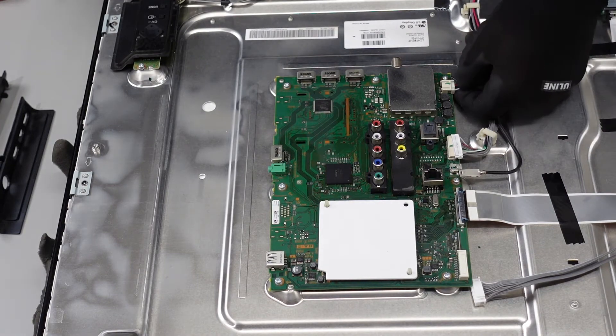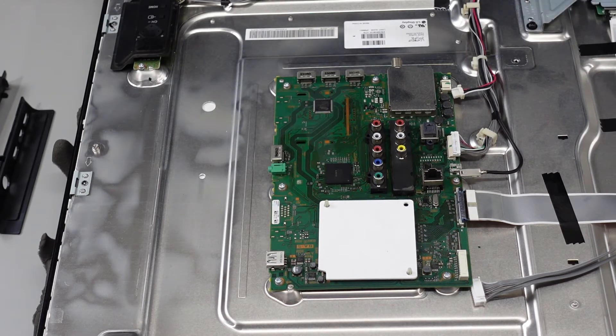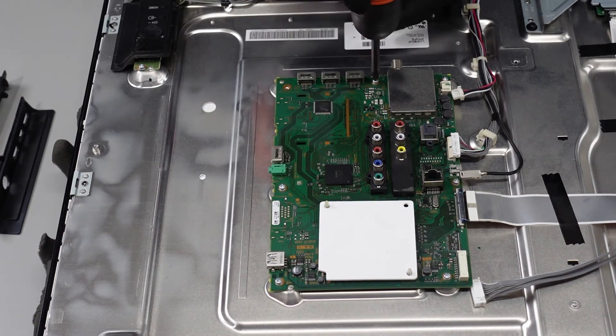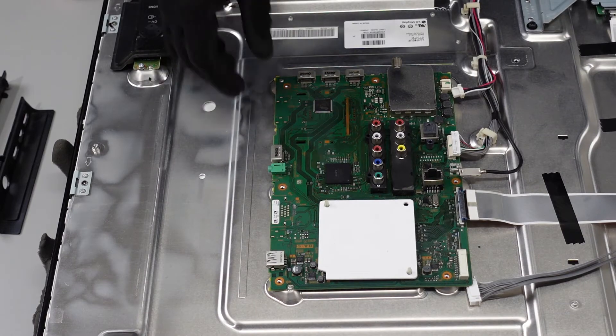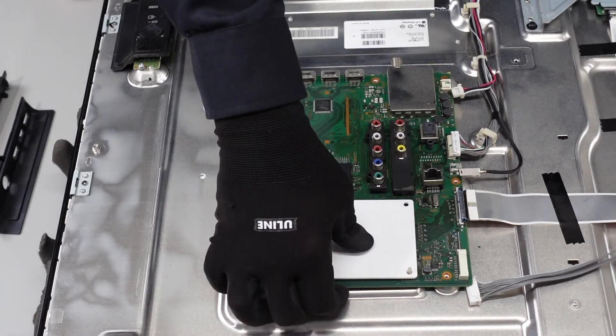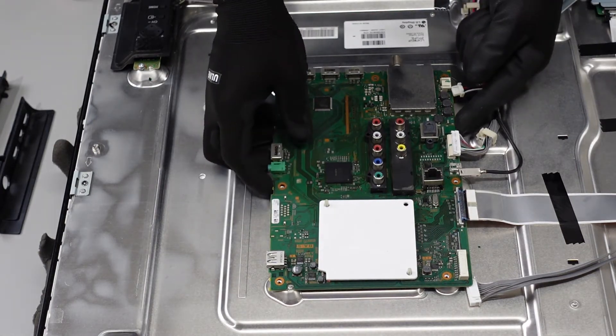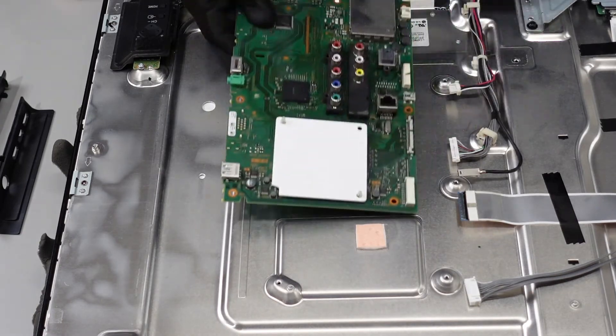This next one is another where we take our thumb to press the small lever to unlatch it and it should just come right out. We've got about six screws or so and this should come away from the chassis. After our screws are removed, it feels like there is just a little bit of resistance, which means there's probably some adhesive underneath this board. Just pop it up — there's that adhesive — and the main board is away.